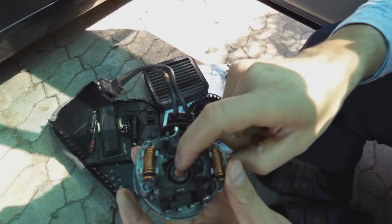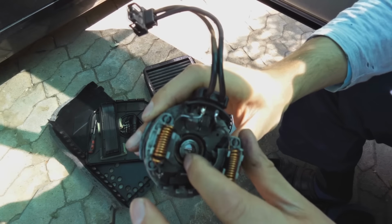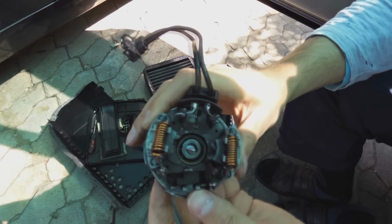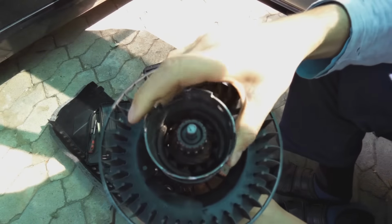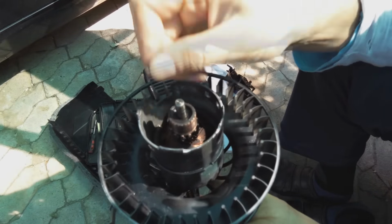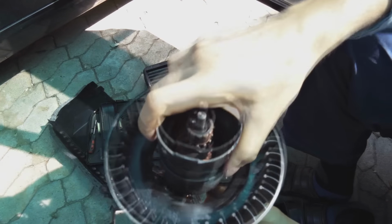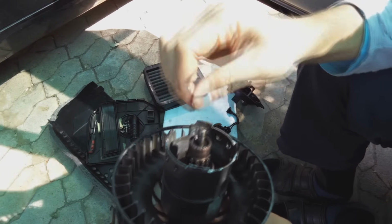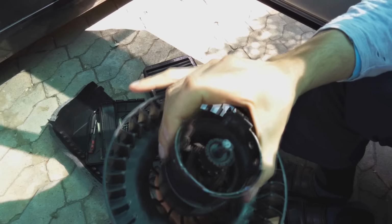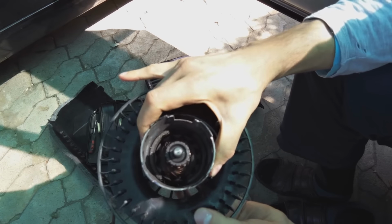The next thing is to clean out this. It's not actually a bearing, it's steel on steel. Clean it out. I put some thinners and I cleaned out the spindle. Right, I then used boiling hot water, I put thinners and I cleaned out all the spindle and commutator area. And obviously it can't turn now because there's magnets inside which are holding it.